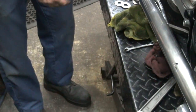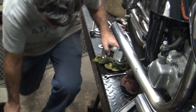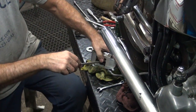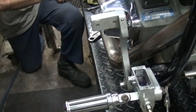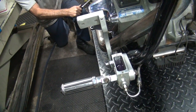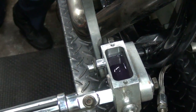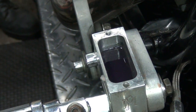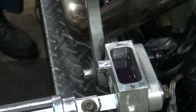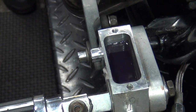Now we're going to go ahead and back pump it. I'm going to blow all the fluid right back up and hopefully no air comes, but if it does, it'll be a good thing. It means there's air in the system. Okay, let's look back there. Ready? Clean fluid. Looks like it, yep. No air? No air. Clean fluid all the way, right?